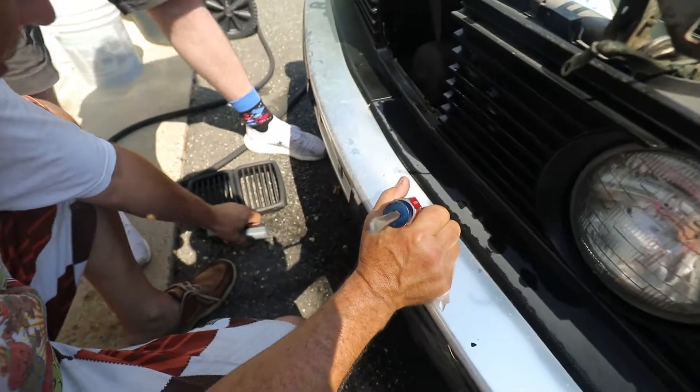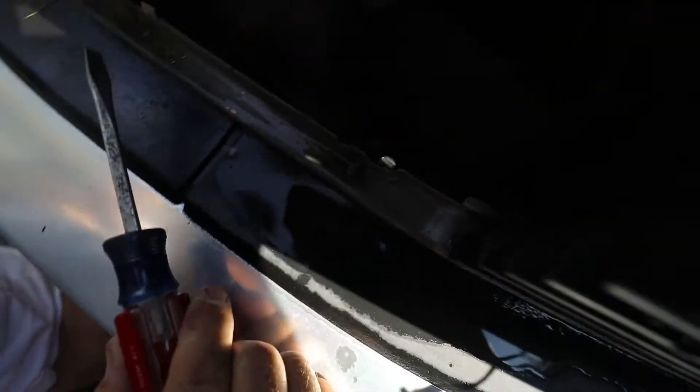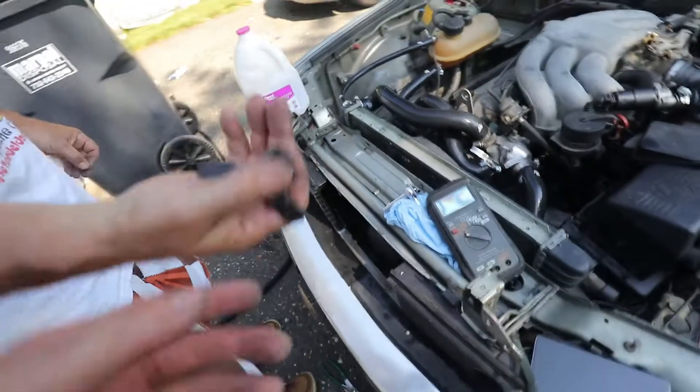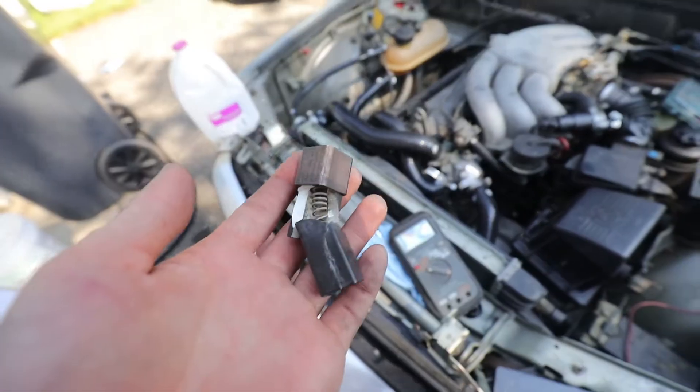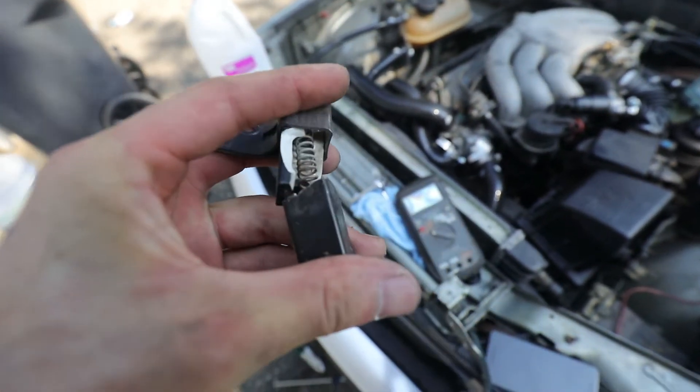Covered in water! What are we looking at here? I don't know. We don't know. That looks broken though. Look down inside here — see right here where my finger is? It is like a spring. It's almost like it broke. Chris, go grab that multimeter. I think whatever this is is not bueno. This is the resistor that makes it a low speed, and it's very broken. High speed — see the bypass. We need a new one.